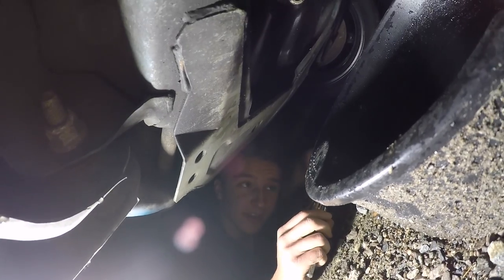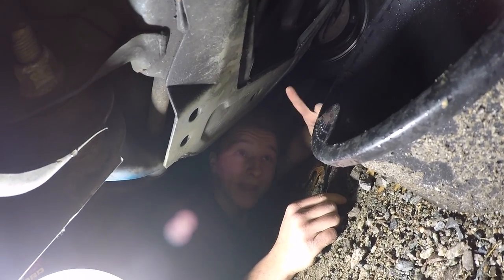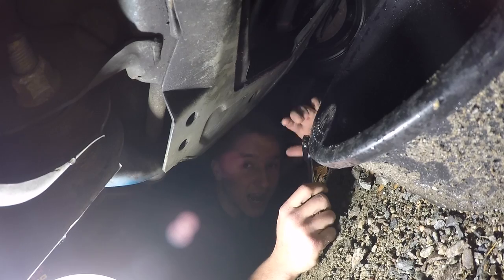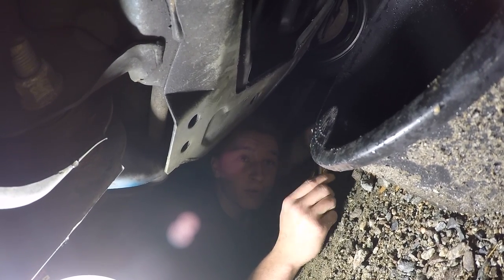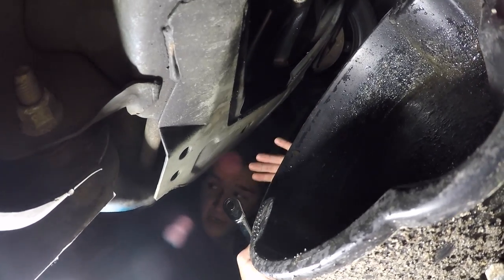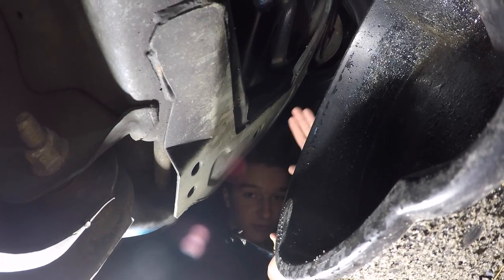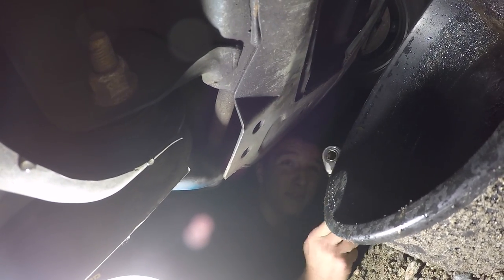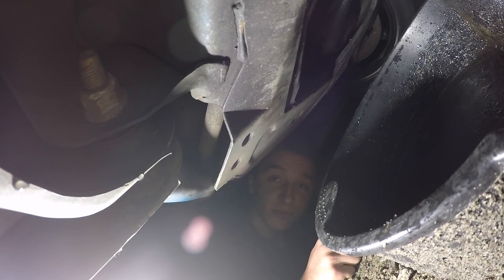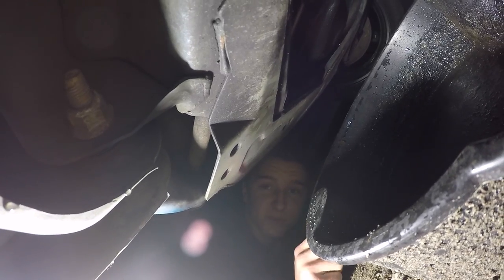It's kind of a tight squeeze underneath here with me and Tyler, but what I like to do first is pull the oil pan bolt. Now, a lot of people pull the filter first or vice versa. I don't think it really matters, honestly. I personally pull the bolt, drain it into the oil pan, then position the oil pan underneath the oil filter, which is right there, and we have the oil filter clamp, which we'll need to pull that off. And then after we do that, just vice versa, put the bolt back in, slap on the new oil filter, dump the new oil, start her up, let her run for a little bit, and pretty much that's it. So we're gonna pull this bolt.